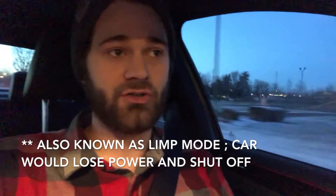Basically what was happening — the reason why my car was dying — is because the electronic stability control had an error. So when I was taking it out of the main mode and turning the ESC off, it was killing the car because it didn't have any electronic stability control; there was a malfunction. What it was doing was bringing that code up, which I didn't understand, and it was shutting the power. So I'm going to have to call Unitronic before I go back to Stage 2 again and figure out how to fix that. That pretty much solved the big mystery of why my car was screwing up.